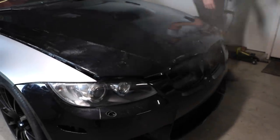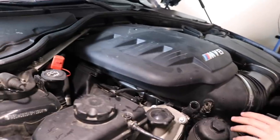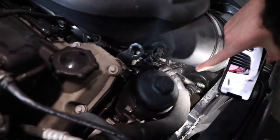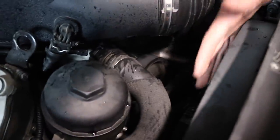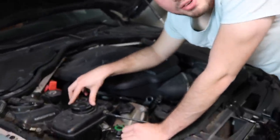The car hasn't been driven in a while. I think we need to top off the coolant. Are we leaking? Coolant is everywhere - it literally got on everything. This is just steam guys, smoke from the engine. We found out that this hose wasn't plugged in properly and that's why we heard the squealing - the water and coolant got on the belt and that made the squealing sound. We're going to see some steam coming out but hopefully it's just steam.